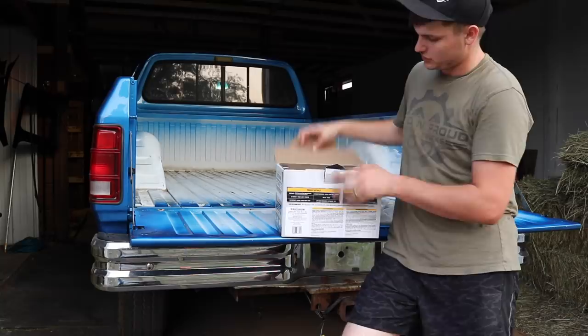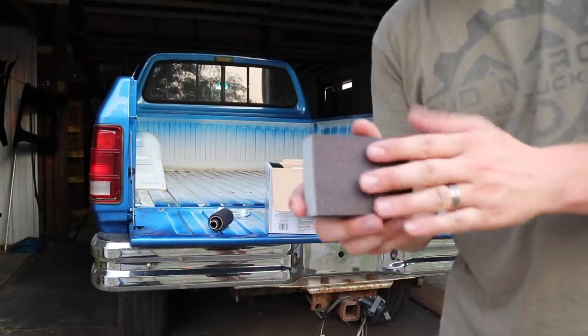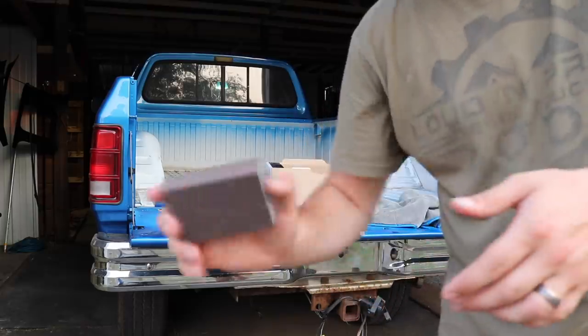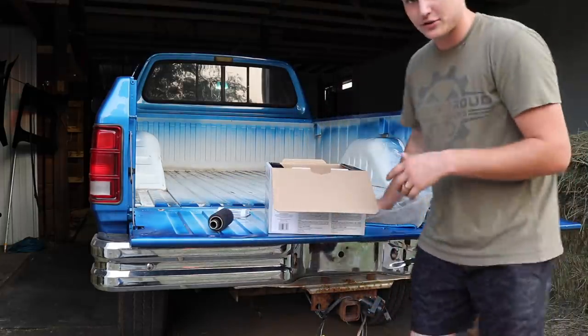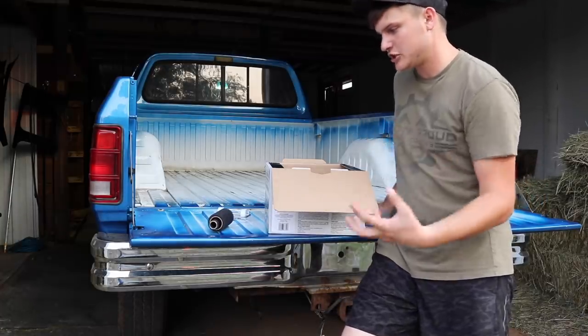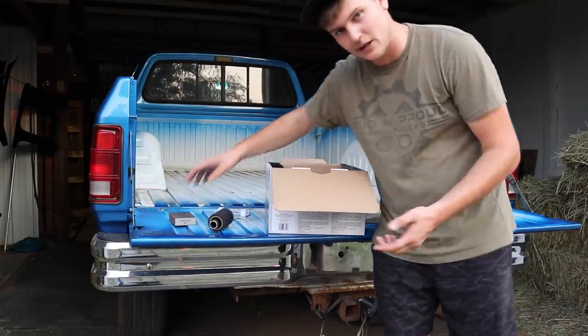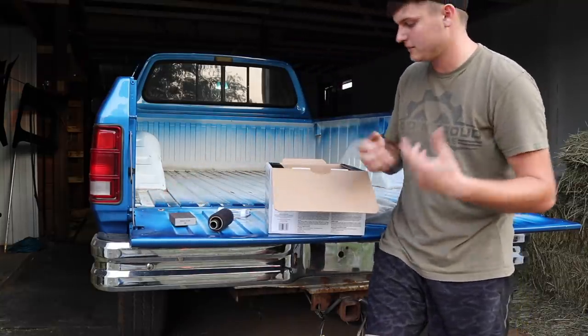Here's the kit — let me show you the basics. There's basically a sanding block, just to rough down the bed to make sure there's no grime, dust, or debris stuck to it that could create issues with the bed liner sticking. Also, if your bed is brand new, it'll scratch the paint a little bit and give it more of a grippy surface to bond to.